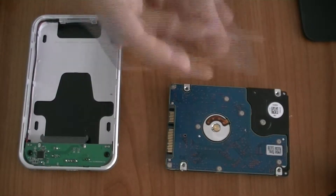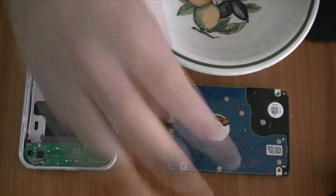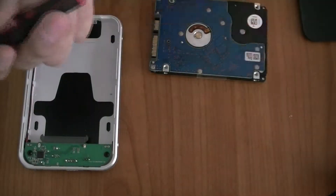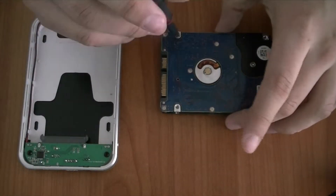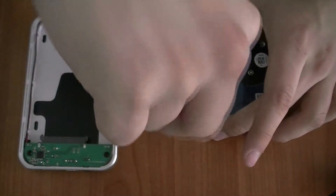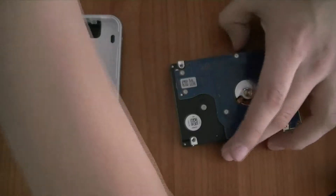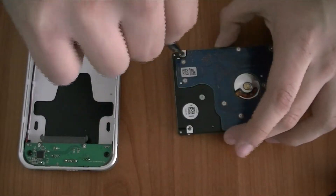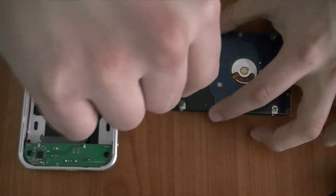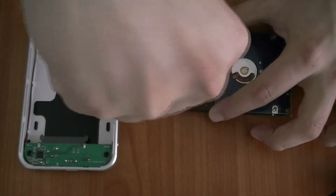Once you do that, you are almost done. All you have to do now is take your old hard drive and fit it into the device to make it an external hard drive. Open up the bag with the screws that came with the device, put them in your bowl so you don't lose them, and take a Phillips one screwdriver. Then take the bigger screws that came with the device and fit them on the bottom of your hard drive. This will act as a stand so that your hard drive won't be floating in the case.